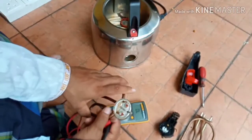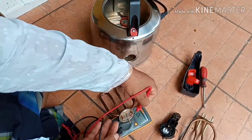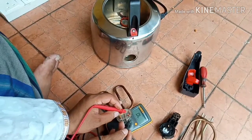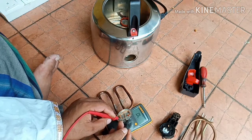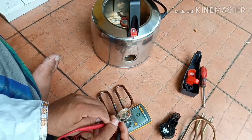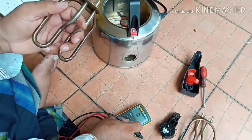I have a good one — this is from another kettle. First, we will check the heating element. The heating element is okay. From heating element to the body: no resistance, no short. If there is a short, then it will trip again. So no short — this is the good one, so we will use it.